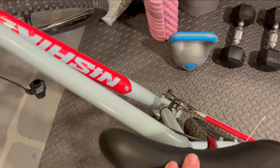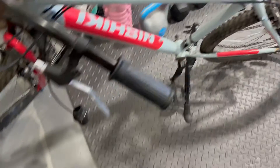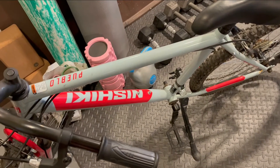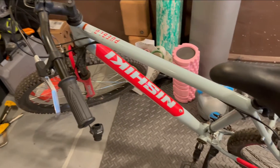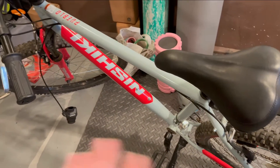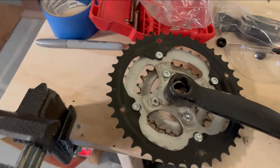This is going to be the point of no return for this bike ever being a bicycle again. I got the tool I needed to get this front sprocket assembly off. I've decided to go with no pedals — I'm going to do foot pegs instead. When the motor's at full throttle the pedals would have been spinning at like 3.3 revolutions per second, driven by the motor. If your leg or toe got in the way of those pedals spinning that fast, it's dangerous. With this powerful a motor I wasn't going to be adding manual power anyways, so just safer to go no pedals and straight motor drive.